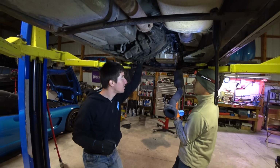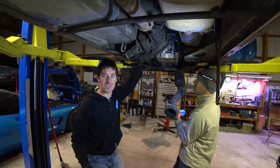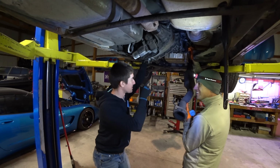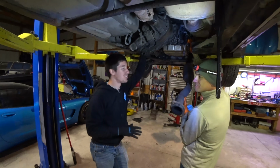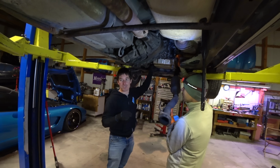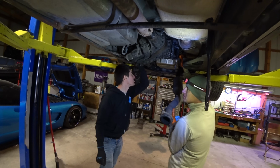Torque converter's filled. I mean, we're ready to go. Oh, new gasket up in between the transfer case and the transmission. We had to go on a shopping mission, of course. And we also had to replace the bushing on the transmission dipstick. Josh and Elliot also went on a mission, and they went and got the little bushing that holds the shift selector cable to the actual transmission lever there.